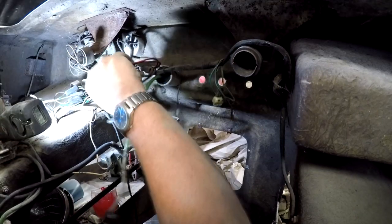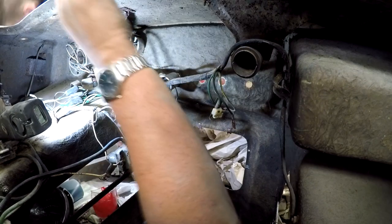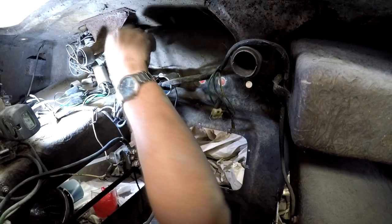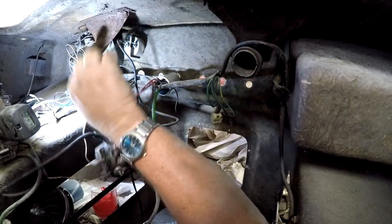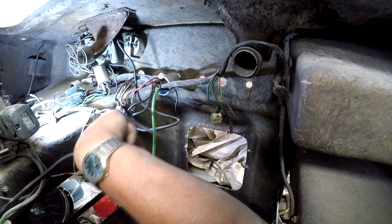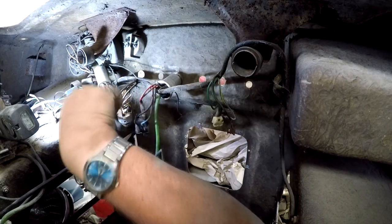Right, that clock — I need the pliers in there. The little amp meter — if I take the cables off of the back of the amp meter, that's it. That one goes to that side of the solenoid, you can see that — that's the one on the right. And the other one back there goes onto that little connector, which obviously goes over to the battery, I would have thought.